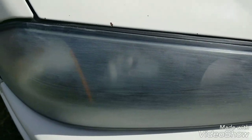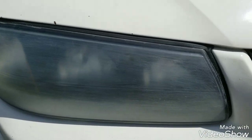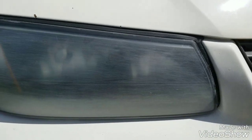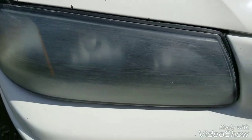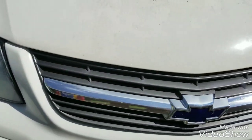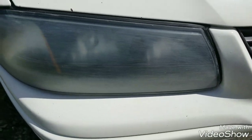If we get to coat these up, they would look awesome. But we're going to keep on trying to clean them up a little bit without taking too much lens off. Just to let you know, this is not an easy job. It's not a 1, 2, 3 job — it's a time-consuming job on a really bad lens. On a normal lens with a light haze, you can get away with 1,000 grit, 2,000 grit. But with this lens, no — you have to go down to 80 grit and up, then smooth it out. D1 New York letting you know — the headlight restoration process is still going. See you in the next video.